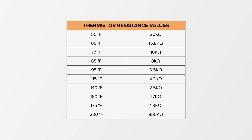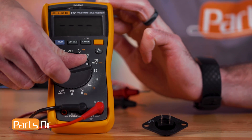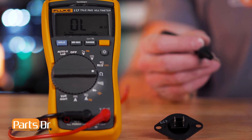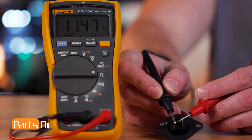Now we will check for a bad thermistor using an ohms test. Unlike other sensors and fuses on this dryer, you cannot use a continuity test to check if the thermistor is working. When testing with the multimeter, the resistance value of the thermistor varies depending on its temperature. Reference the chart showing the resistance values at different temperatures — note that all thermistors have different resistance scales, so this chart only applies to the part number being tested in this video. To test, turn the multimeter to the ohm setting. If using a manual ranging multimeter, set it to the 20k or 40k ohm setting. Touch the probes to each of the terminals. At room temperature, the thermistor should have a resistance just over 10k ohms.